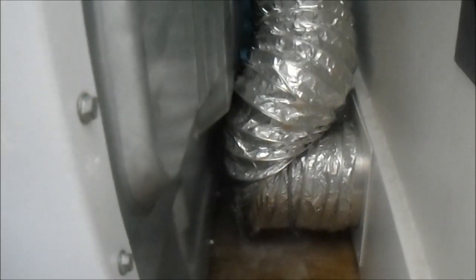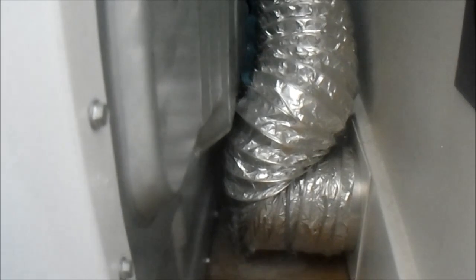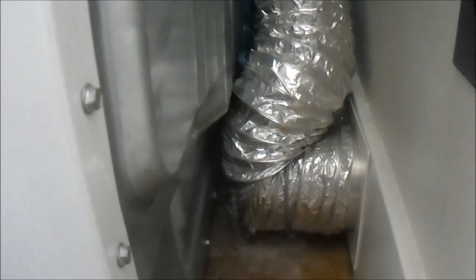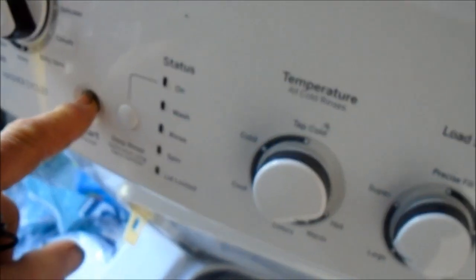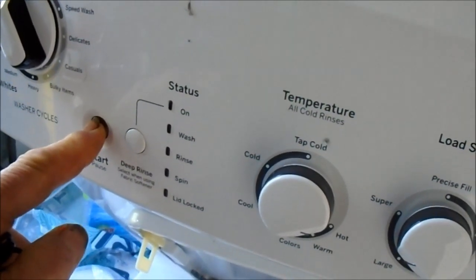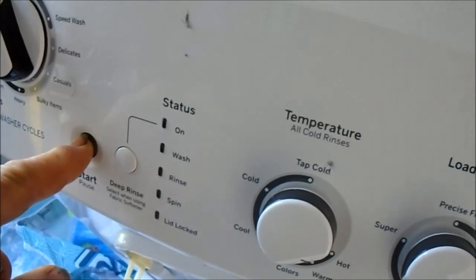Basically we're going to reset the mode — hard reset, CMOS reset. And when I'm down here looking at this thing, I'm thinking, how does that vent work? 40%, 50%, 60% of dry repairs are related to flow, guys. So this is a no-no if you have your vent kinked like that. When we do the hard reset, basically we'll unplug it, push the on button, activate some of the switches, hold the on button for about a minute, push the dryer button — basically draining any little capacitor that may hold some sort of memory. That's what I call a hard reset, a hard reboot.